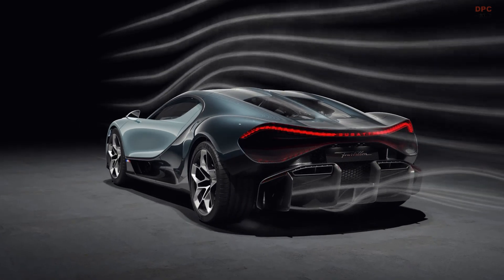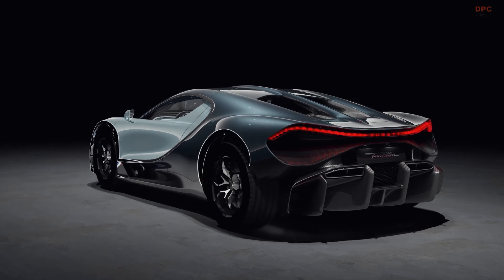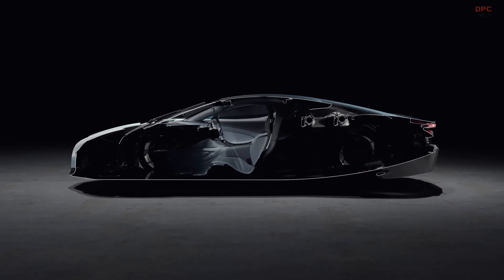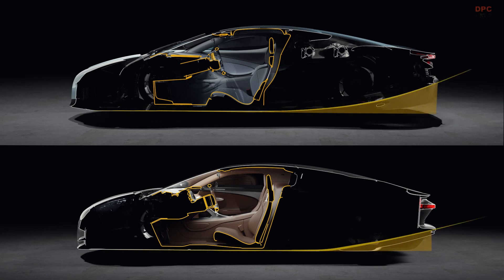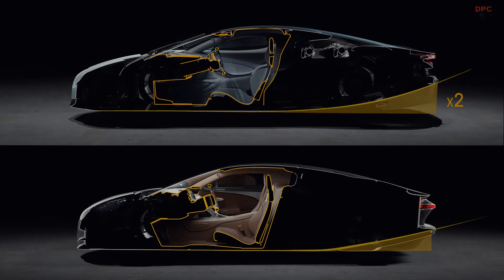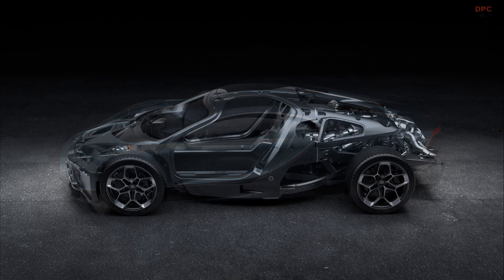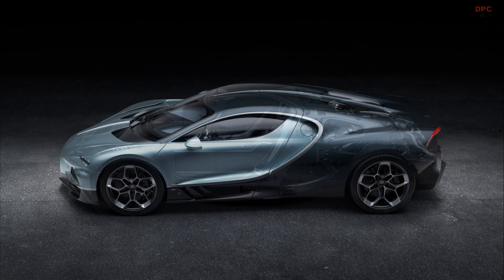Overall, you can see why it was very important for us to have the ability to do a whole new platform, to properly optimize and integrate all of the technologies in this car. Here we have the main monocoque of the Tourbillon, and there are a couple of key technical features. One is that the seat will only go up and down — it will not slide backwards and forwards. That helps us to keep the wheelbase short, which helps with weight and package, but also helps us to keep the overall weight of the car lower.